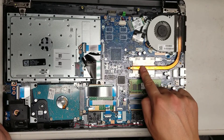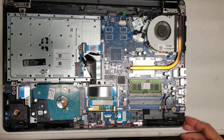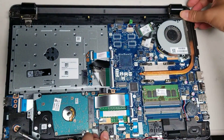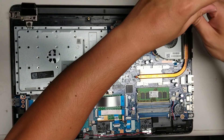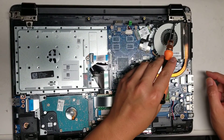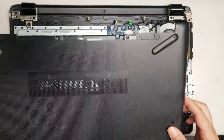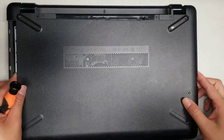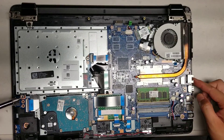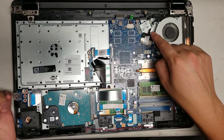The CPU is soldered down to the board, so you can't upgrade it. There's one connector here — I think it's for the power button. The fan actually has a screw hidden underneath this cable. It looks like somebody may have opened this before, because there are missing screws I haven't touched — a screw missing here and a screw missing here. If you work on this computer, just know you might have some extra screws that this video isn't showing.